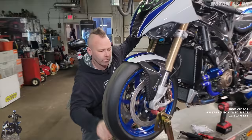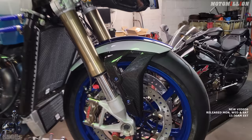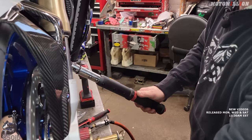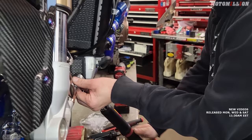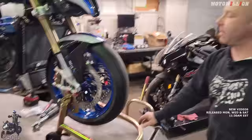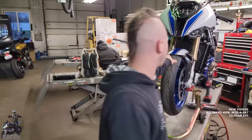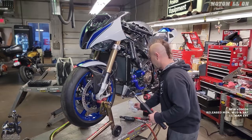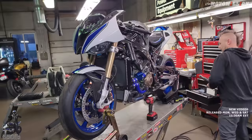Take the time to torque everything and center everything up real nice this time, because hopefully it's the last time the front wheel is coming off. Hopefully we can get it to stay that way once we torque the calipers — that's the tricky part. You can hear the brake pads dragging a little bit, but they'll wear in once it gets out onto the road. Everything's new — new brake pads, new rotors, thicker rotors. It's because there's no dowel pins in the forks — that's why we have to take the extra time for the extra step.